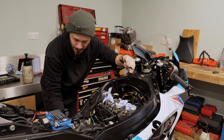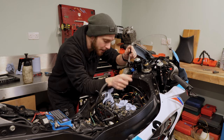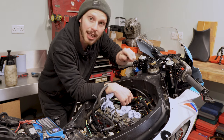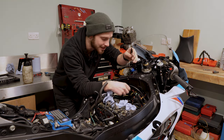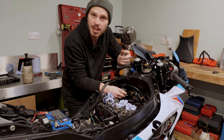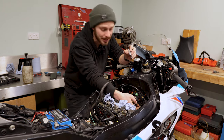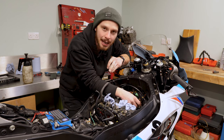Talking of giving away information — something really common on sports bikes is fitting quick shifters. What they do is put a break in the ignition circuit; there's a plug on either end of the coil. When you hit the gear lever it momentarily cuts the ignition, meaning there's no load on the engine so the gear can just slot in without pulling the clutch or letting go of the throttle. That does mean you get a bulk of non-factory wires underneath that can be really hard to diagnose. For ease of use, if they're not colour-coded — like these ones with a yellow flash — just mark them up with a pen. Factory wiring is usually pretty logical and the lengths are correct, but aftermarket quick shifter systems are usually universal fit and can be a nightmare to trace.